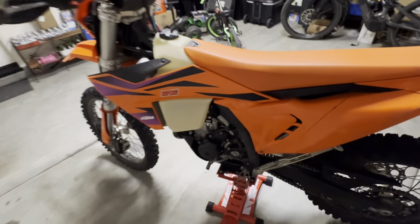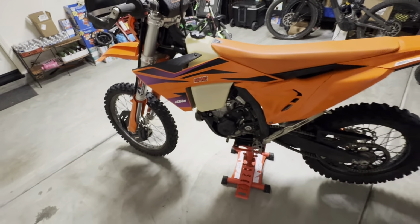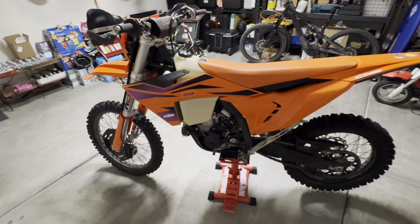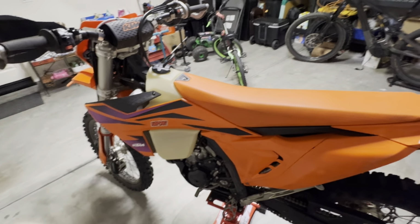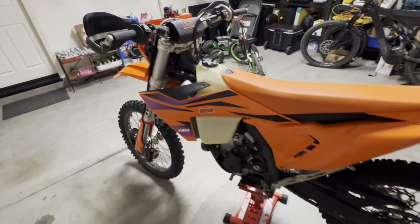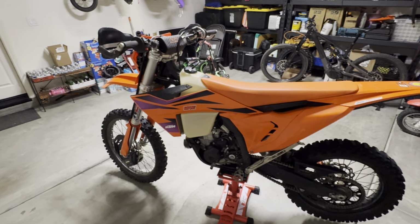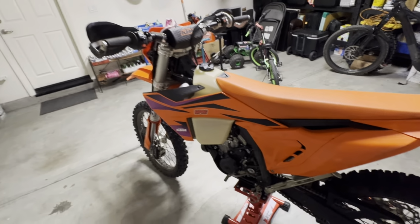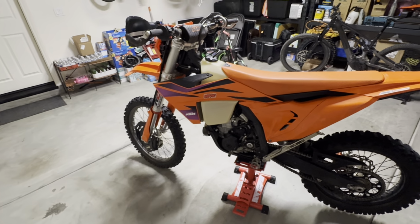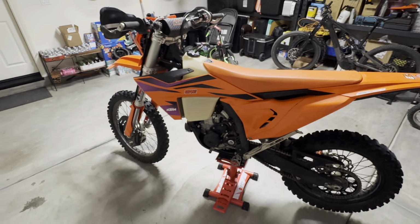Okay, what else? We did this fuel filter by Pinnet. So that's Dave from Best Dual Sports Bikes. I'm not affiliated with them by any stretch. So I got the filter from him. I got the ECU, which I think they cracked, and then they were able to load another tune that's comparable to Vortex. I could add a switch for two different maps, but I got used to the aggressive map and it's doing its job. It richens the bike up and it runs like a beast.